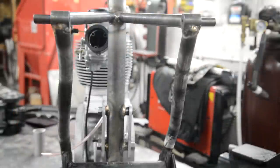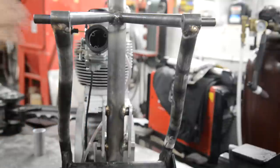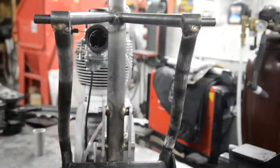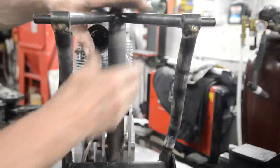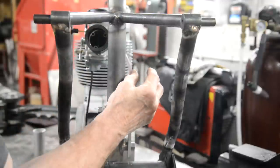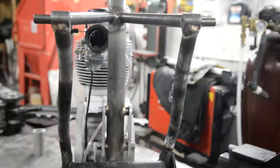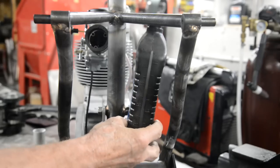Right now, although I like mad bikes to look like the era they came from, the one concession, or a couple of small concessions I make to modern riding techniques and so on, is to keep them as slim as I can here. So in here, without it sticking out too much, we've got to fit an air box and an oil tank. Now for an oil tank, I want it to be about a quart. A litre of oil is enough. So there's a litre of oil.